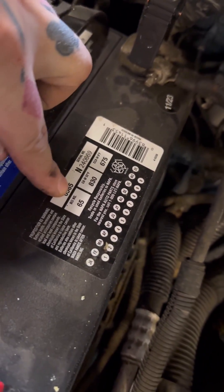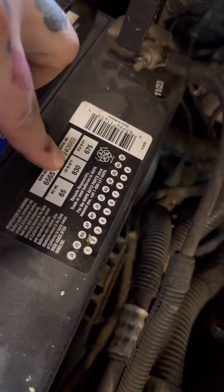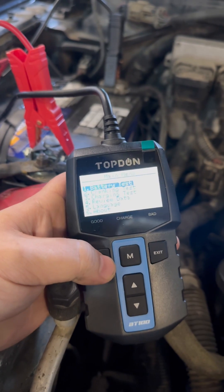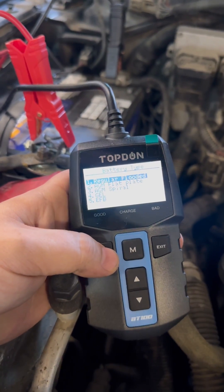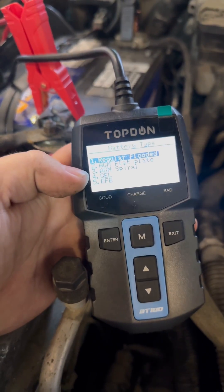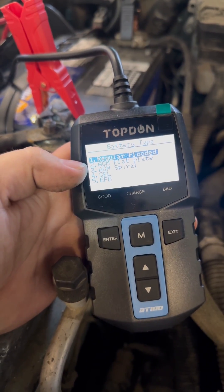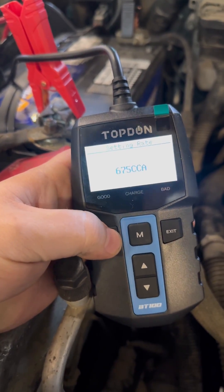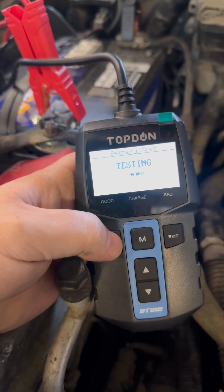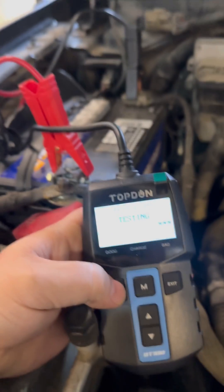Your information is always on the battery: BCI is 65, cranking amps 830, cold cranking amps 675 — that's all you need to know. For the battery test, make sure you don't have a gel battery or AGM battery. We're going to set cold cranking amps to 675 and hit enter. It's pretty much dummy-proof — all you have to do is look at the sticker on your battery.